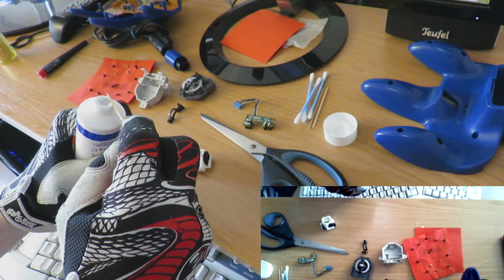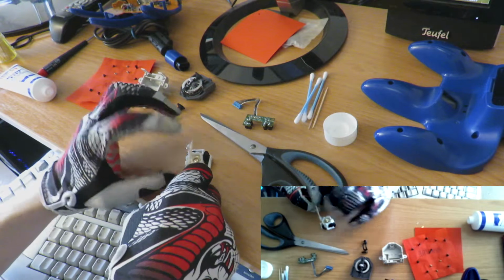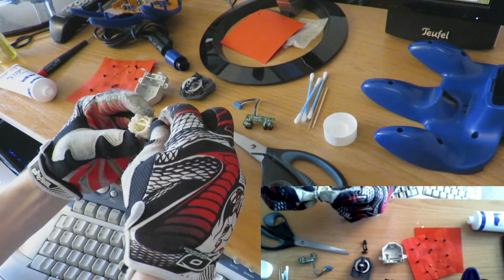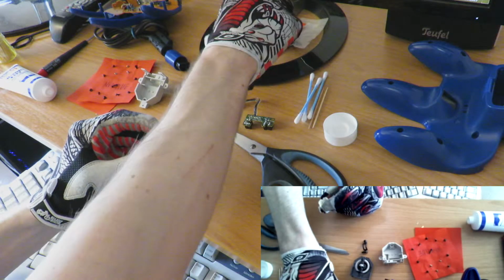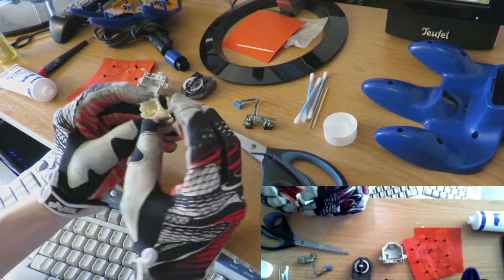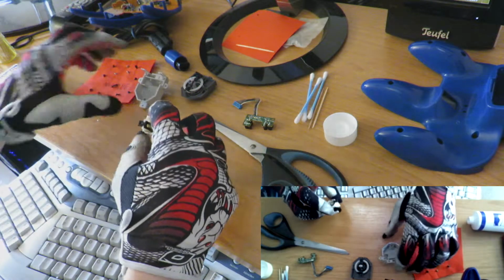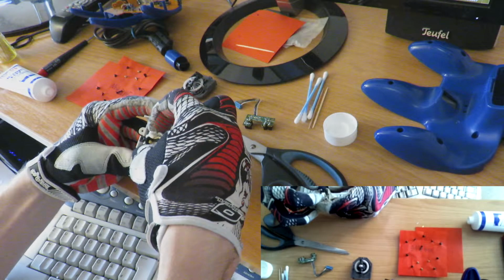You take some of the silicone grease with the toothpick and put it on the Toffifay disc. Doesn't matter if it's a little bit too much. It will press out of the case later by itself. Press the black plastic mechanism on it and move it up and down. The silicone grease will extra prevent your controller from wearing off and last longer, but no guarantee for Mario Party sessions.